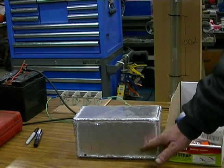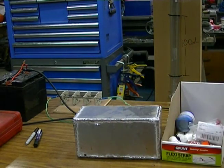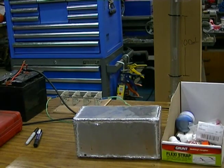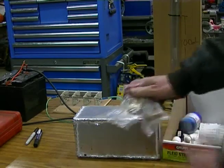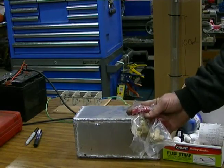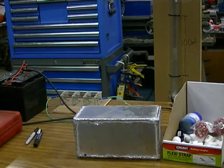As we know, if the fuel level gets higher, it's going to require more vacuum to pull the air through the fuel. So if we keep it at a constant level, once we've adjusted the carburetor the governor should take care of the rest. For our adjustments we have two gate valves — most people use ball valves, but I'm using gate valves because we can adjust them to a much finer degree than ball valves, which are just too imprecise.